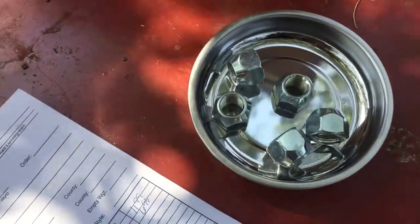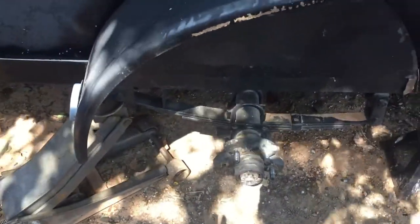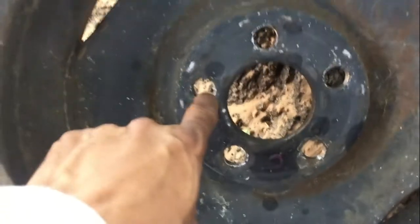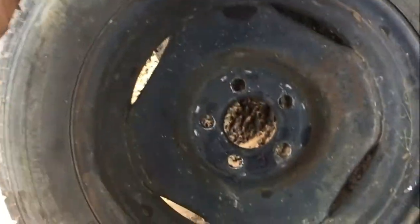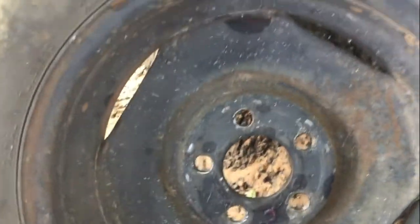I forgot what they charged for the lug nuts. I'm over here at his place — real close quarters, confined, tree right here — but this is as far as we could get it. Luckily the bearings are still good, so we're going to pop these studs out and replace them with new ones. We're also going to have to get a different rim — see how it wallowed these holes out, made them real big. I'm not going to reuse that rim. Luckily he's got a spare on top of the trailer, so we'll use that. He'll have to go get a new rim because that one would just be wobbling and vibrating real bad.